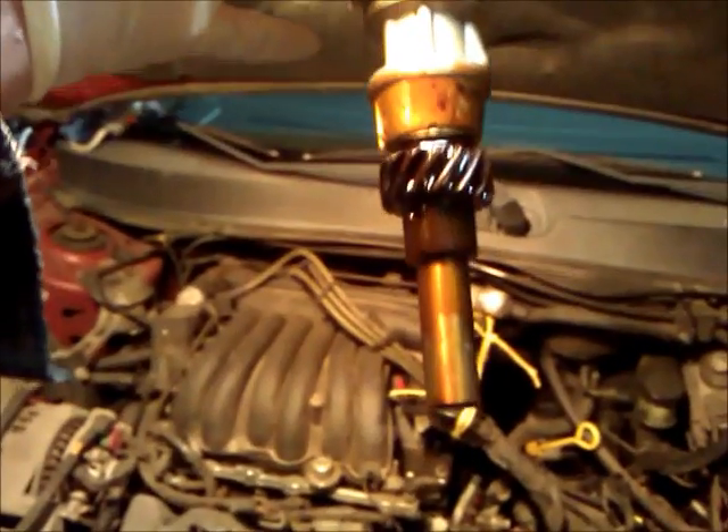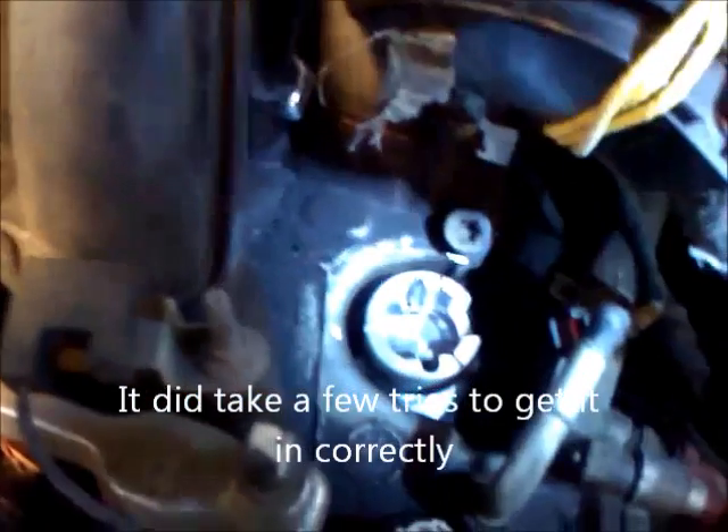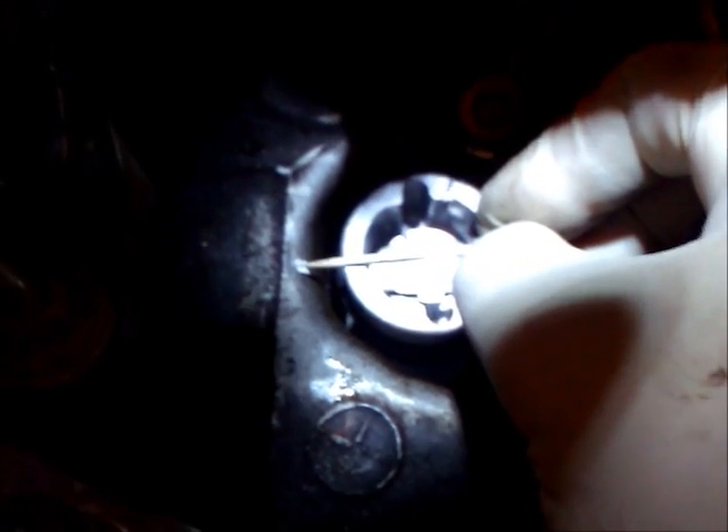You can see there's the hole there. Down in the bottom is a little rod that drives the oil pump, which lines up into the bottom there. To make sure it goes back into perfect position, on top there are some grooves — I put a toothpick in it, hold it flat, and then mark on the engine block with the white-out pen. There are three grooves through all three spots.